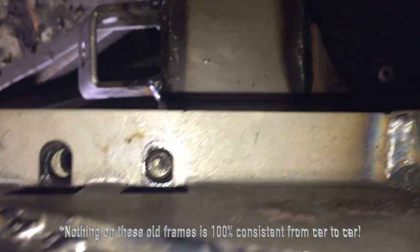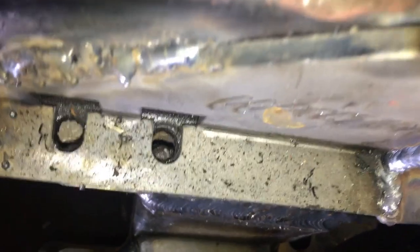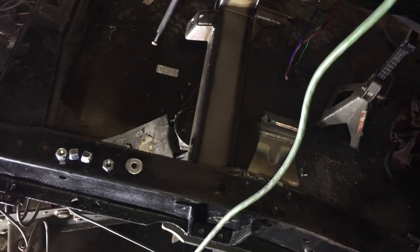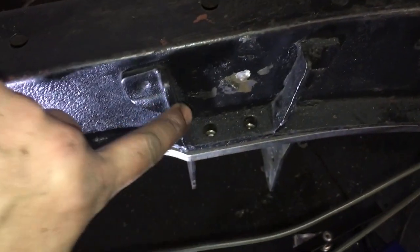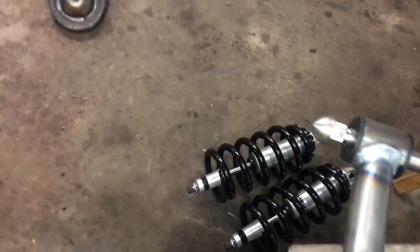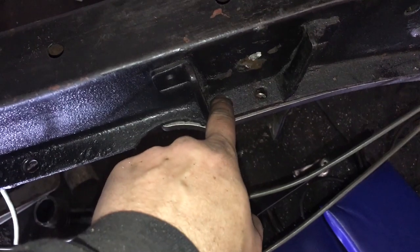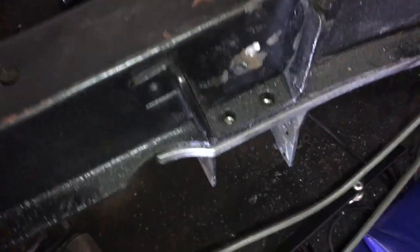So mine doesn't quite line up — but hey, at least I'm not leaving anything out of this video for you guys. That one lines up nice; this one right here, not so much. After I get those to line up, I might be able to get those in. Let's drill that out and see what happens. Before you install your outer side bolts for the crossmember, you want to take the front one off according to the instruction manual. I'm going to take both of mine off because I have the thicker coilover shocks and I don't want to do that twice. I'm actually going to reuse this bottom plate because it might give some extra strength for holding the crossmember in — a little extra, but I'm going to do it.